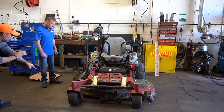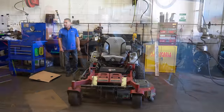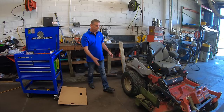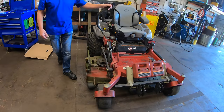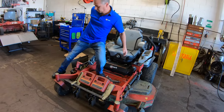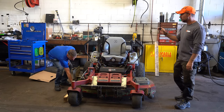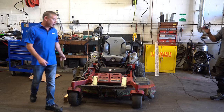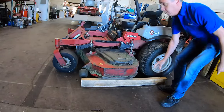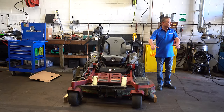You wouldn't split the difference and go down this line or cut back on the other side. So we've got the most level ground we can work off from. The first thing I'm going to do is check to make sure these caster forks have even ground pressure. I pick the deck up and just use any board or whatever blocks you've got. The boards don't have to be the same size because all I'm using these blocks for is to take the weight off the machine. This deck is probably a 60-inch deck — it probably weighs 250 pounds. If I take the weight off it, I can tell if I have a light caster. If I have all the weight hanging on it, I probably can't feel it.